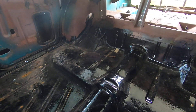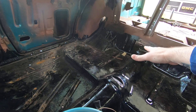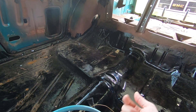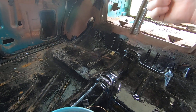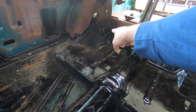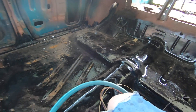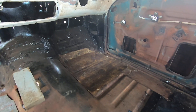The one that broke off was a total surprise — I've never had these break because the threads are exposed sticking up with a square nut. When you take a body mount bolt out by hand with a ratchet it'll start turning then seize up, and usually you can run it back in and out a little bit at a time to work it free. I kept doing that over and over and finally it just snapped off. I'm going to stick the chisel blade of the air hammer up underneath the edge of that square nut, knock it off, and weld a new one on — at least that one will be easy to get to.